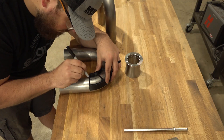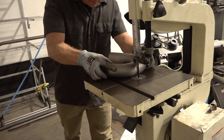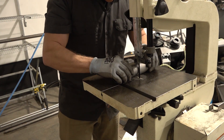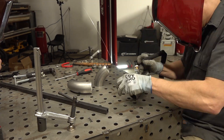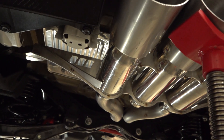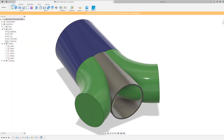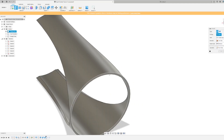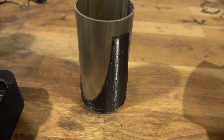I printed two parts to help make this merge as simple as possible. Since we know the distance between the resonators and we know the centerline radii of the bends, we know exactly what angles the bends need to be to cut the merge into the oval tubing and have it fit perfectly. By printing a piece with the exact angles we need, we can guarantee we get everything symmetrical and fitting just like the model. To model the guide for the notch, this can be done pretty quickly by modeling a sleeve around the center tube. We've been using the combine cut utility to remove any material where the tool body touches the sleeve. You do this twice for each of the bends and you have the centerpiece that we wind up 3D printing. This is a difficult merge to pull off by hand and this saved a ton of time to make it perfect.